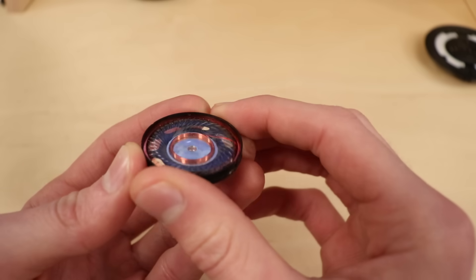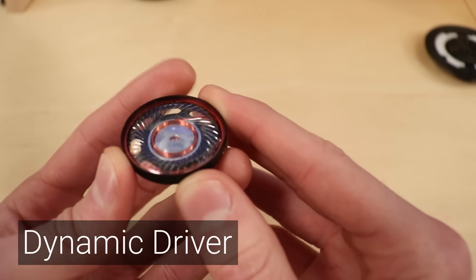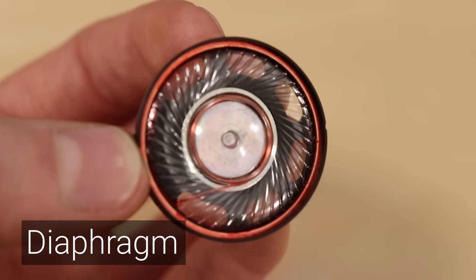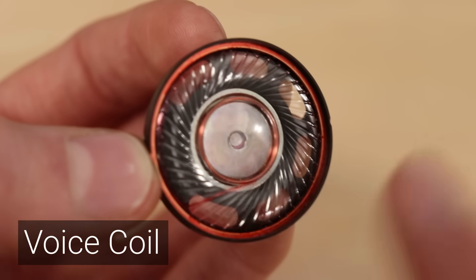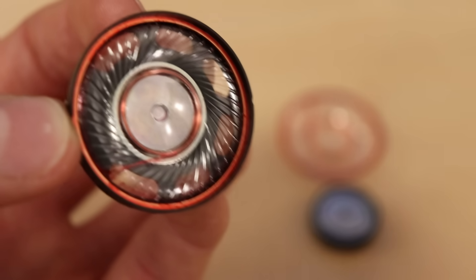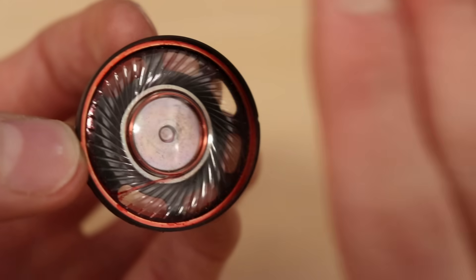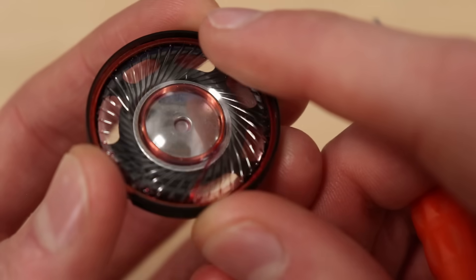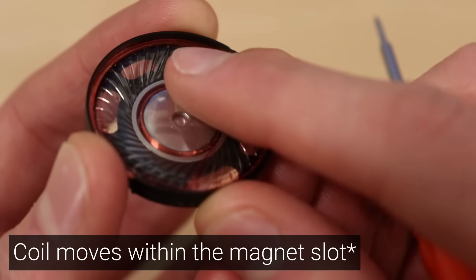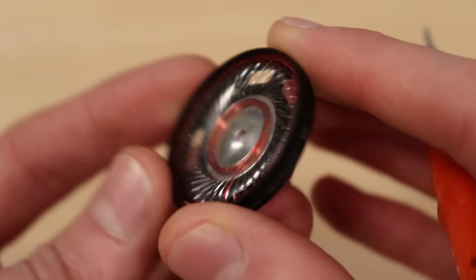This is the most common type of headphone technology, widespread across most headphones — it's called a dynamic driver. There are other technologies; check the description to find out about those. This dynamic driver has three main parts: a clear transparent diaphragm, a copper voice coil, and a permanent silver magnet in there. I took one apart earlier so I'll be able to show you all these parts in much more detail in just a moment. What this transducer does is transform the electrical signal into a mechanical movement, pushing the diaphragm in and out. This diaphragm is suspended freely and can move up and down — and this movement is what creates the sound pressure waves which we perceive as music.